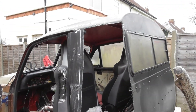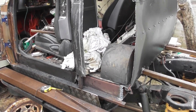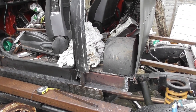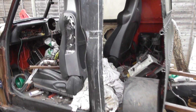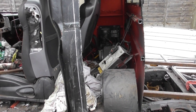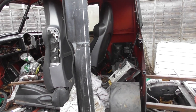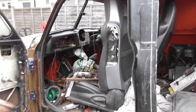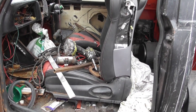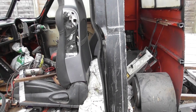Most of that roof will be gone, the bulkhead will be gone. I just want to get the first door hung - give myself some ideas of where I'm heading with this, and then the same on the other side. Once I've got the hinge for the other side, well, I don't even need the hinge. I just need to get in there, get the hydraulic pack out, cut these wires to the old ECU I was using, get the speakers out, get this stuff up because it's flammable as hell. Then we can chop the other side - but I might have to remove the driver's door because it's right where I'm plasma cutting and I don't want to destroy the electrics. I've removed the airbags, so I don't mind if I cut a few wires, I just don't want to cut all of them.